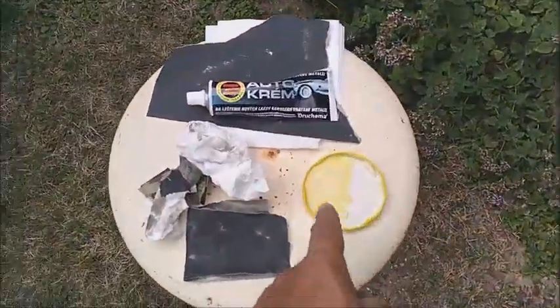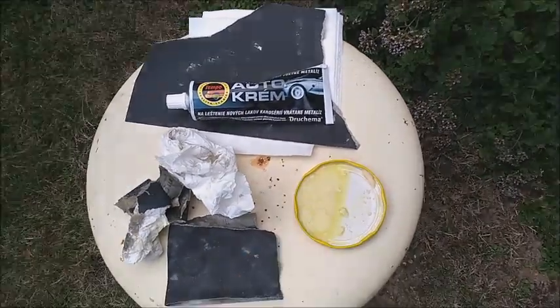For me, I'm gonna continue to the finer sandpaper, and I just wanted to give you the hint that if you want to remove the scratch, now is the time to make it vanish, and then you continue for the smoothing. So now after I reach the 2000 sandpaper, I'm gonna start using the same compound, which is the mixture of the liquid soap and the cream.